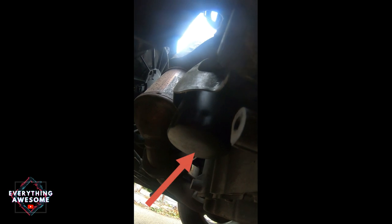In a 2013 Chevy Malibu, I'll be using a 15 millimeter socket. Once we get this drained, we're also going to pull off the oil filter, which is right here. When you take this off, make sure that you have your oil bucket — what I usually use is just a cheap bucket from the Dollar Tree for a dollar — and I pull that off and drop it in, and any excess oil will also be coming out of that.